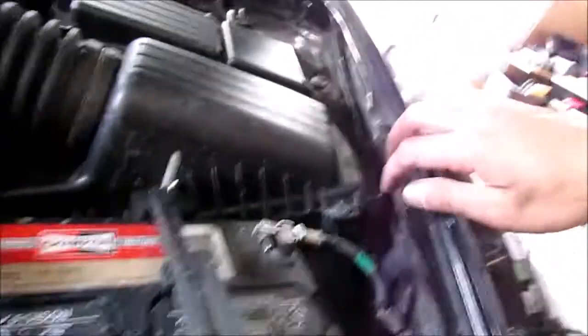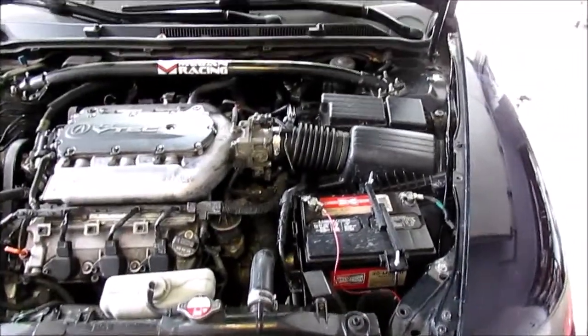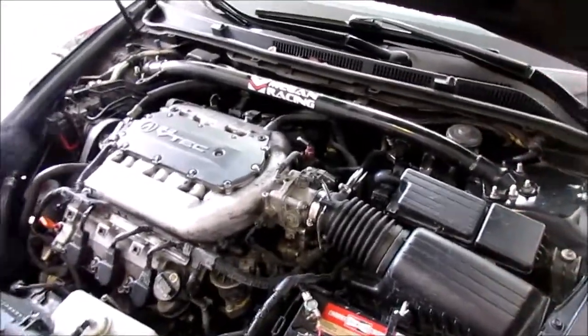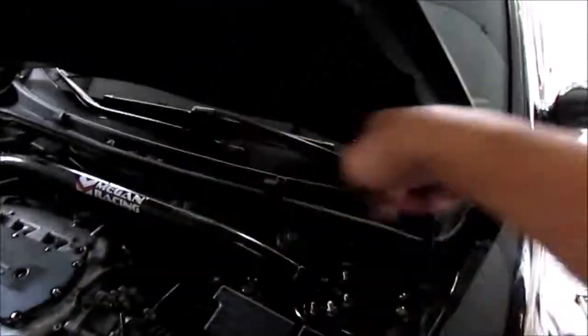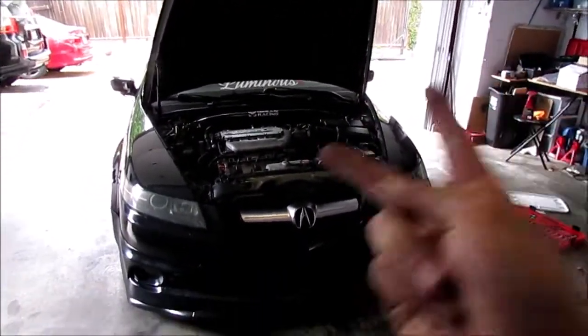So you connect the red wire to the positive side, and then I ran the wiring that goes inside around the liner of the body. I could just zip tie it onto here if anything. It goes through here and down into this compartment where the air intake is, and then you connect the whole entire thing. I hope this video helps you guys out. The reason I couldn't go through there is because I couldn't find a wire grommet. Since the button location is on this side, I decided to wire through this side instead. I'll be linking the wiring harness down in the description below. Peace out.